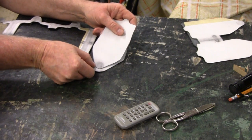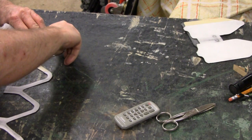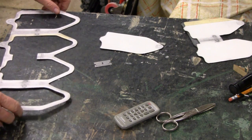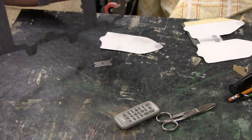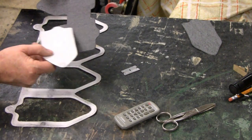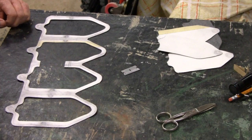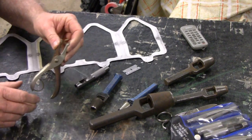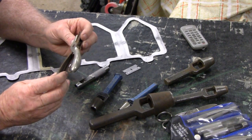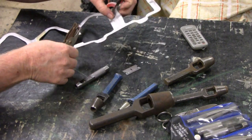Okay, got a little bit right there and there we go. That's the gasket, and now we just gotta put the holes in it. I'll show you how. Don't throw the little leftover pieces out because there's still a lot of material there for cutting gaskets for carburetors and stuff like that. Alright, here's what I use for the small holes — I don't know what size that is, maybe quarter inch. See how rusted they are — I've used this thing for 40 years or so and it still works perfect. Only costs a dollar at the store.